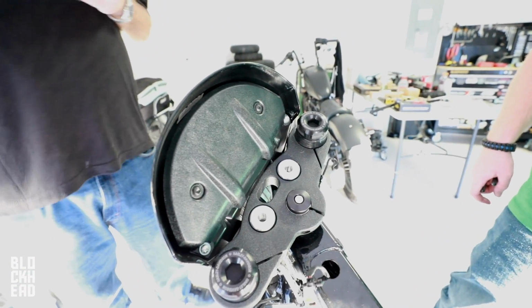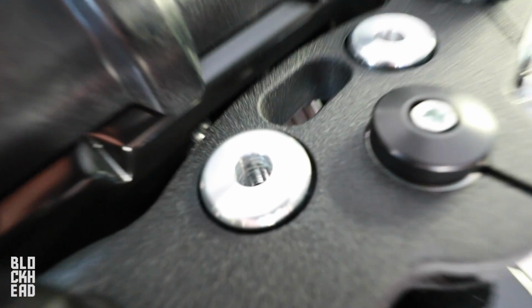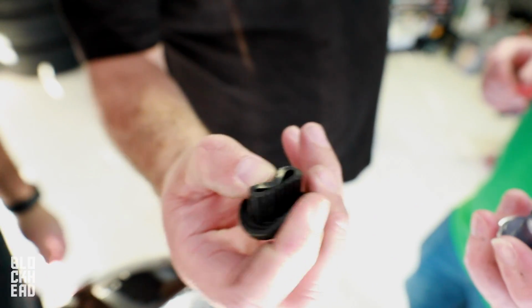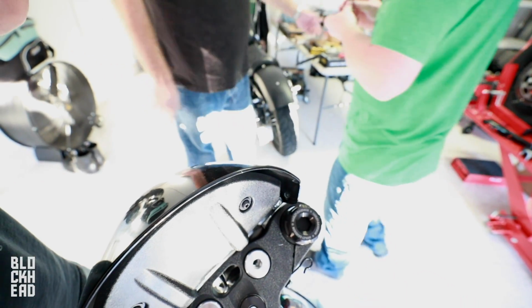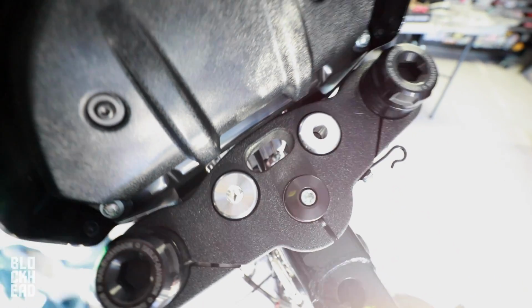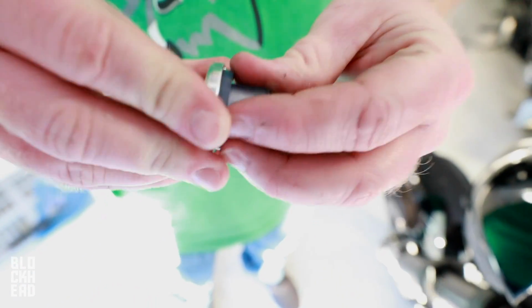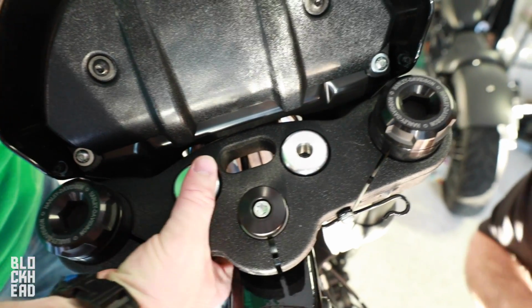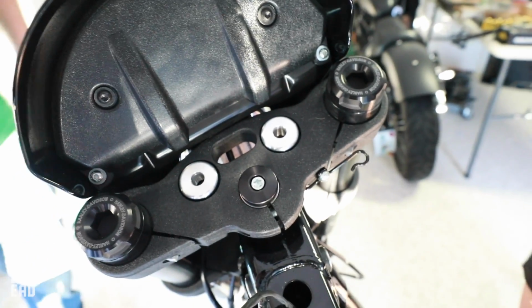Beautiful. It's perfect. It's like polyurethane? Yeah. The cheap rubber ones, and then these are the poly ones. Awesome. Always get those when you do bars. So they absorb more vibration, right? And they don't flex as much because the taller they get, the more leverage. That's all it is. Piece of plastic. Once you put the handlebars on, it'll clamp them in. So you just gotta set them in there.